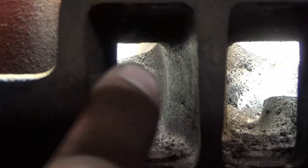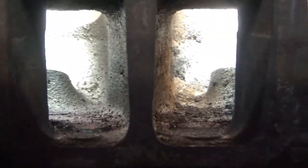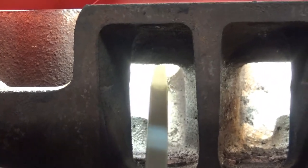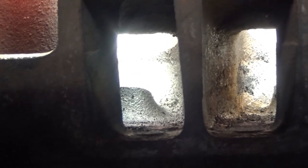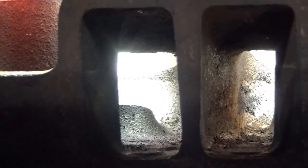This is kind of hard to see on camera, but all I can really tell you is that the 081 head has a little bit smoother surface inside — a little bit less roughness. The only thing I can really observe inside the port is that around two or three inches in, the 081 castings seem to be a little bit more opened up in that area — though I'm not actually measuring it with anything, so that's just my opinion.